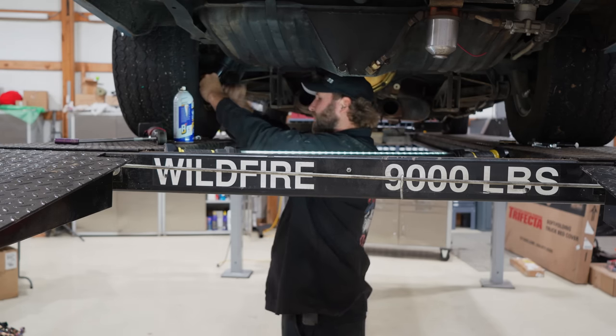So if you remember when we picked this rig up, it had a new fuel make it happener right out of the box, kind of loosely bolted up on the intake there. And the reason was the old big dog Holley double pumper was pouring fuel everywhere, it was in bad shape. So that feller just put this one on to move it around, I think was the intention. Ended up using that to get it home. However, it's significantly undercarbed and it's just not the right setup.